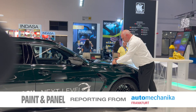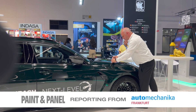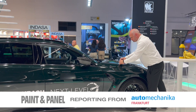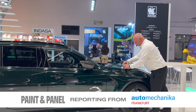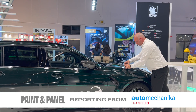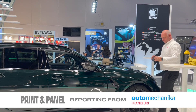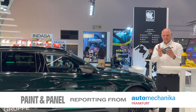What's the actual reason for doing three? Because it's going to capture information even on one, isn't it? That's exactly right. Parts of the vehicle will show different elements of colour depending on whether it's a vertical or horizontal surface. The substrate's different. I'm sure many of you have seen where a plastic bumper is painted off-site, it comes in and it's just a little bit different from the vehicle. So this helps make sure that the colour match is really very close.